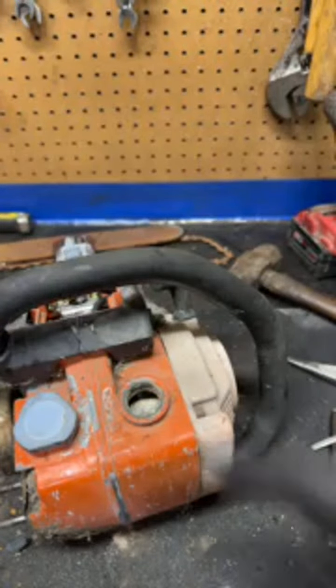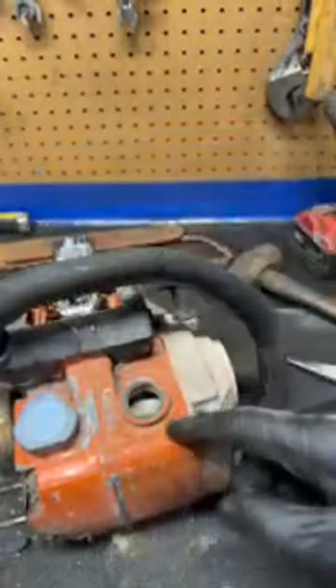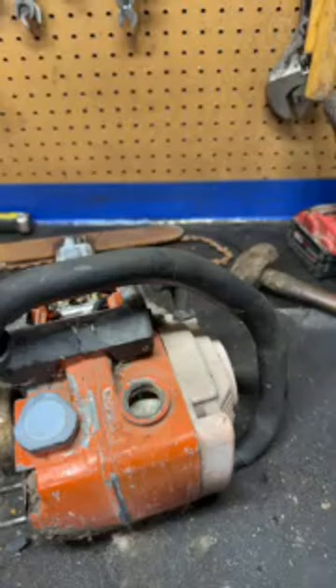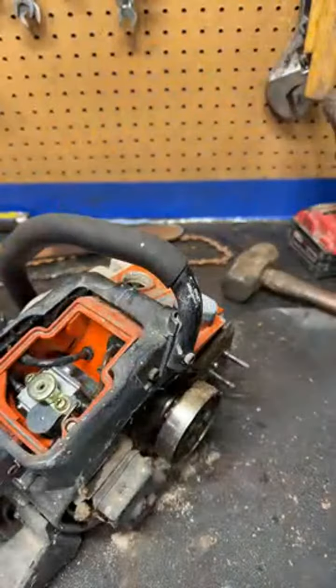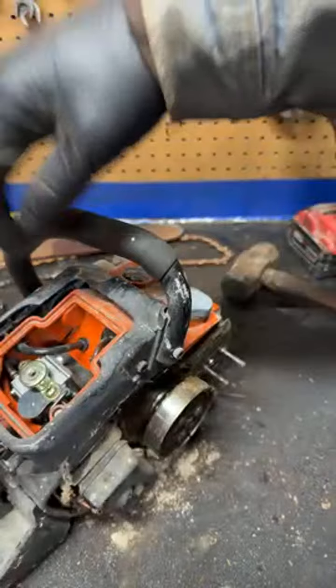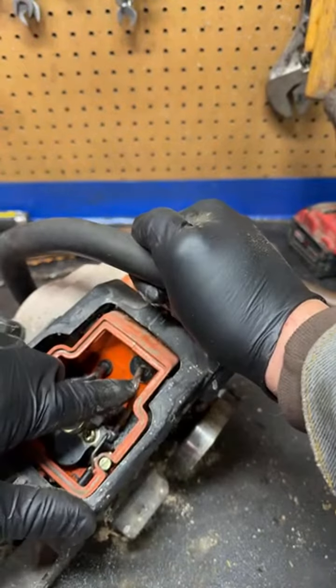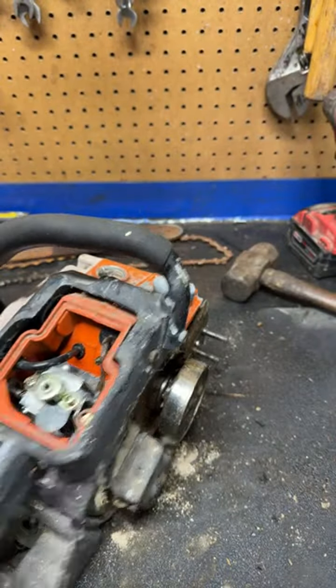Yeah, the inside of that tank is all corroded. I mean, in order to save the saw, you'd have to take care of that, because that aluminum or magnesium that's delaminating would plug up your filter every time. So this thing would have to go in, I think, an acid etching bath is what they use, vinegar, stuff like that. But other than that design, that fuel line is so hard. Scared to even touch that.